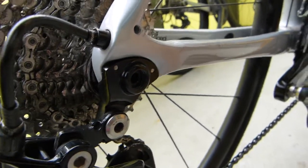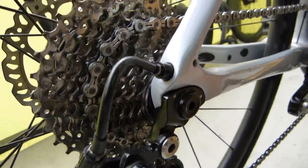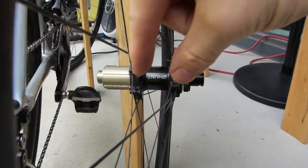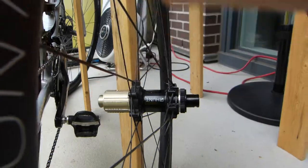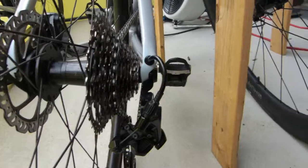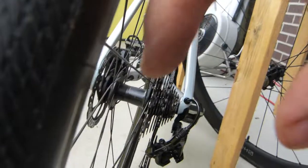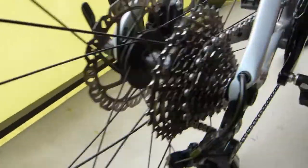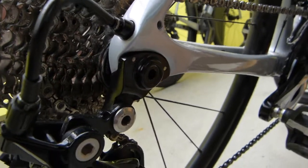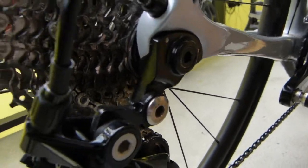Not ideal. The axle obviously must have full thread engagement, and if you make the spacer to spacer assembly longer inadvertently by spinning one side and not noticing it, then this is going to push the frame there, widen the frame. And one way to tell that it has happened is if your axle doesn't reach all the way to the other side when it's fully tightened.